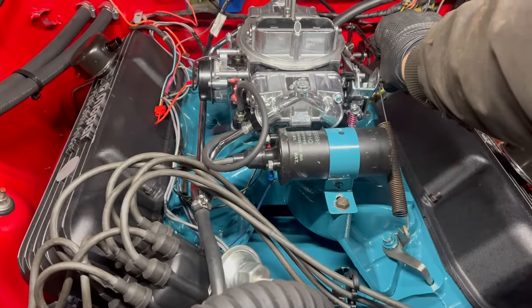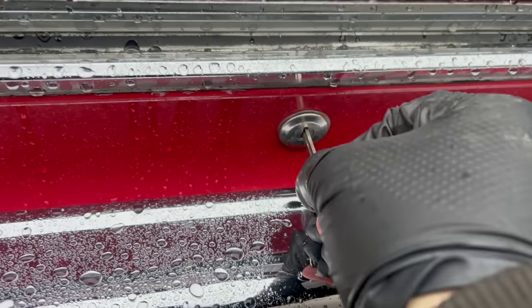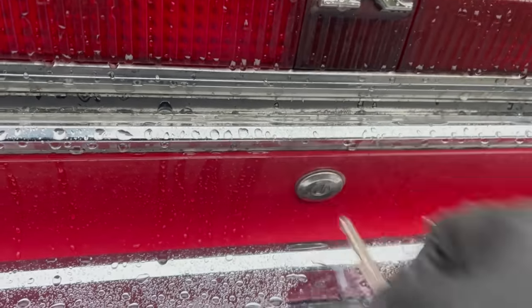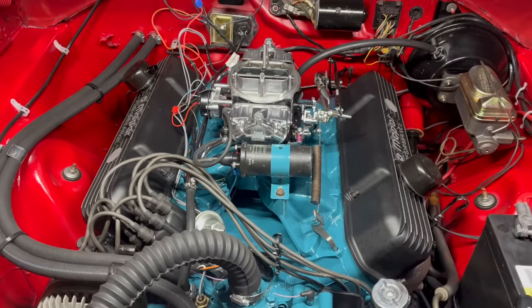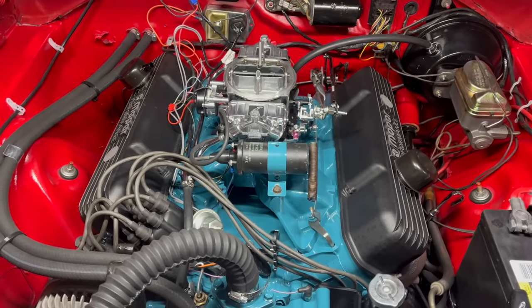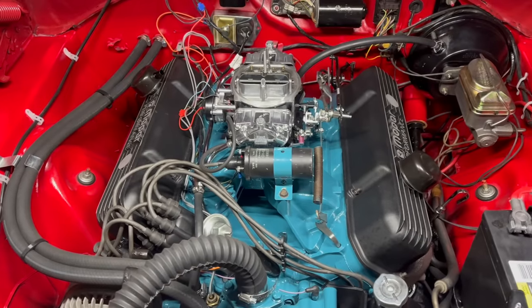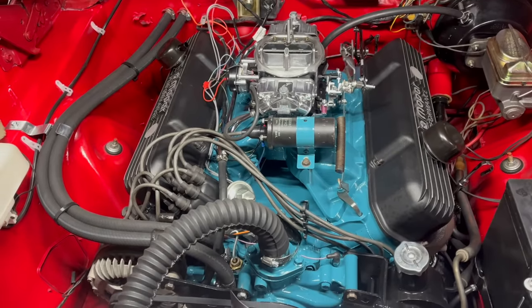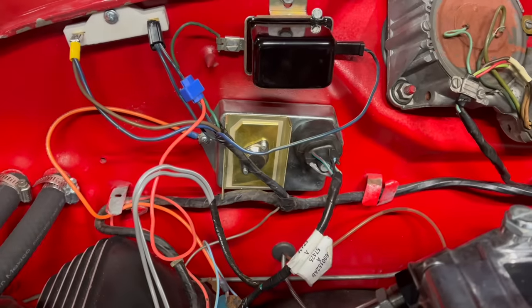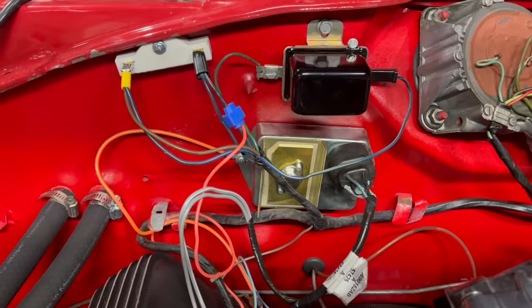Okay, that didn't really make any difference. Only hardcore Mopar people will understand that this is wrong. There's more spare ignition stuff here if it comes to that. I only just noticed these are those fancy stealth heads — the main way of telling is there's no opening surrounding the heat crossover, which is non-existent. They're really well hidden under that paint. For science, I tested a spare module. No dice. Moving on.